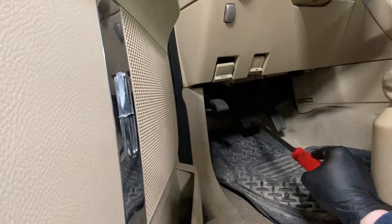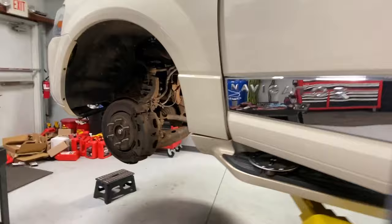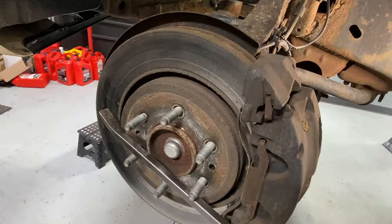We're going to apply some brake pressure, do it a couple times, really put on the brakes. Then release — the brakes should spin free once again. I've got a pry bar in here and it can't even move it. So in order to figure it out, come to the backside here and pop that bleeder.